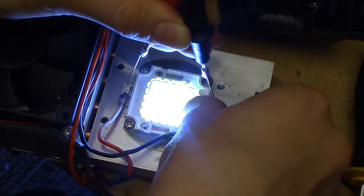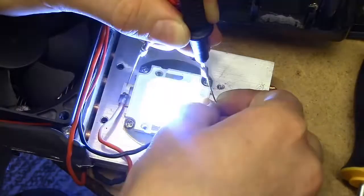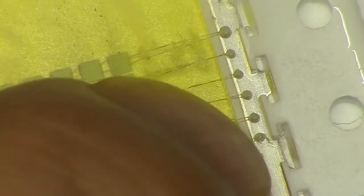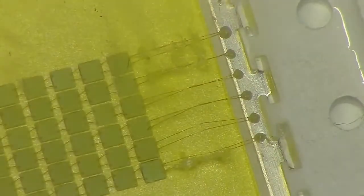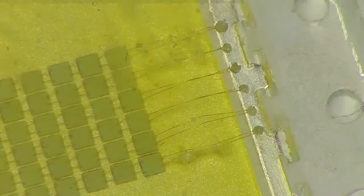21.5V at 30mA it seems. I've certainly never seen a power LED fail like this before. With zoom right in there, you can actually see the ball around where the bonding wires just let go. I wonder what's caused that. The metalwork around the LED seems to indicate it's run very hot, so perhaps it's just overheated with time. But it almost seems as if there's been a little spark where they would like to go, which has just pushed the potting compound out of the way. Very odd failure mode. I wonder if I can just jab a soldering iron in there and fix this LED.